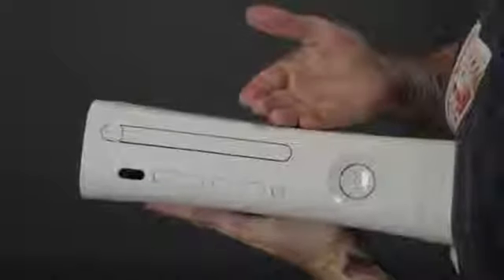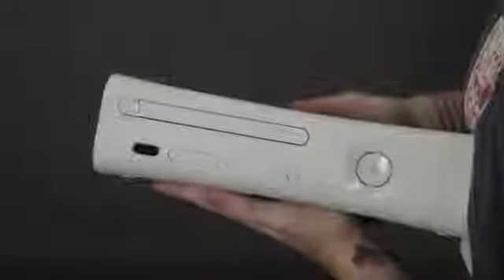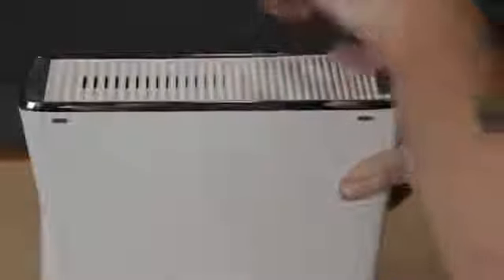To manually inspect, unplug your Xbox from its TV and power supply. If you're looking at an original Xbox, the hard drive size is written on the side of the box. If you have an Xbox 360 Slim, the hard drive can be removed and inspected. On the right side of the Xbox there's a button inside of the grill. Push that button and you'll open up the hard drive enclosure. Pull out the hard drive and you'll see the size written there.